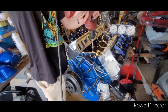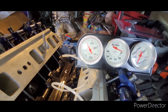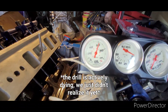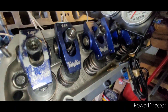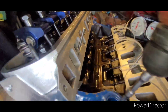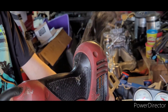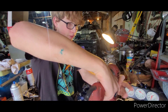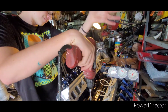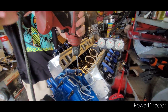Look who finally joined us — we have a new socket. We spin it, keep going, and is there oil coming up the top of the engine? 60 PSI — yep, just keep going. I think they're all good to go now. I feel even better. That burning smell wasn't anything in the engine or the oil pump — it was the drill. All right, I think we're done here. Good job, boy.